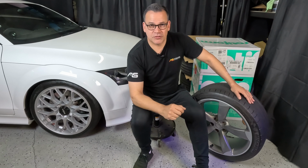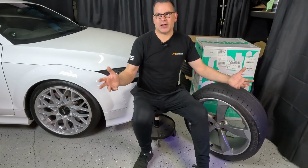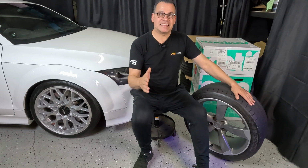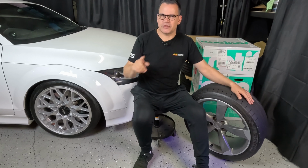Now, if you're going to be changing wheels, there's a pretty good chance you're going to get new tyres at the same time. If you're keeping like for like and they're an identical size tyre, the only thing that really matters is the load rating and speed rating at least are as good as the tyres you take off, or the number that's on the tyre placard that I showed you before.